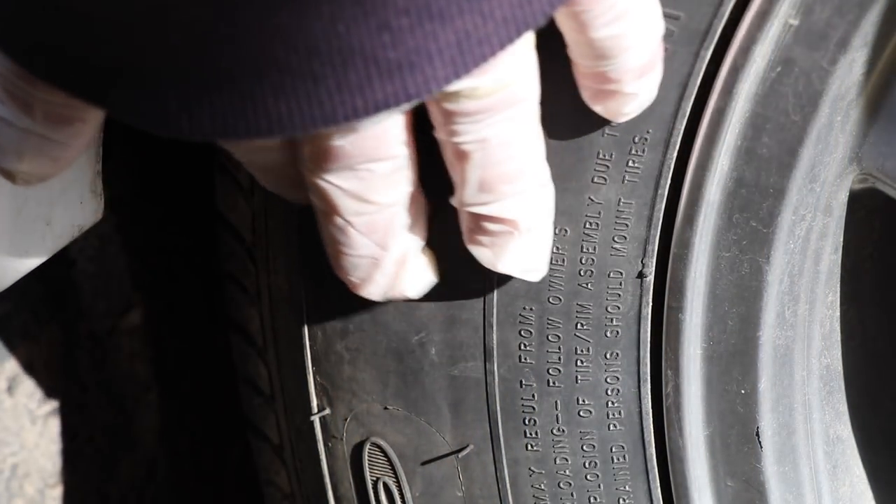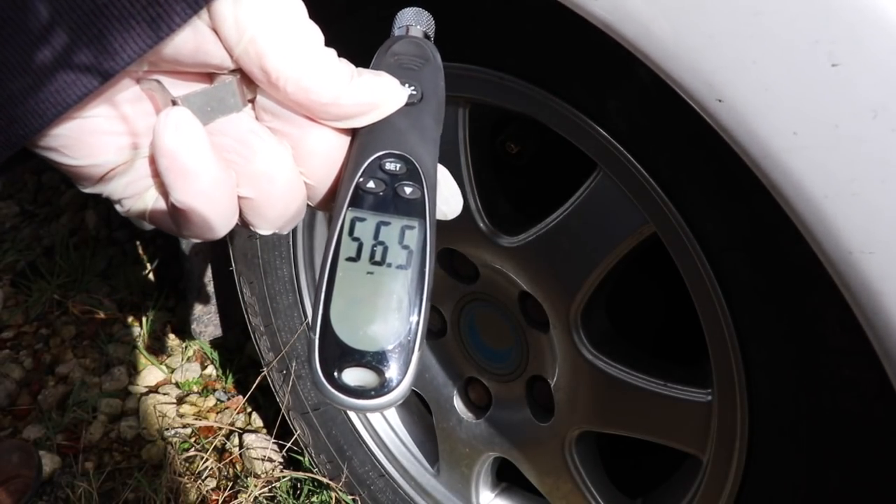Go around and make sure the tread is perfectly okay — get yourself a tread depth tester and plot it around the tyre to make sure it's well within tolerance. One of the most important things to check on a caravan tyre is the general condition of the sidewalls. Because caravans stand still for so long, they tend to crack the sidewalls rather than wear out the tread. Look for cracks, breaks and splits — if you see a crack or split, replace the tyre immediately. Finally, make sure the tyre pressures are correct and check the torque on the wheel nuts. This is something you should be doing before you set off anyway, but it's a good time to check now.